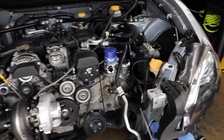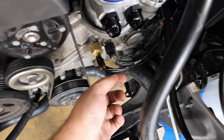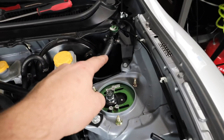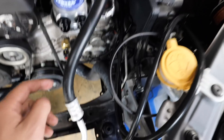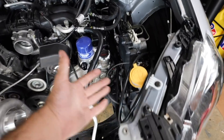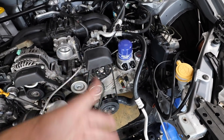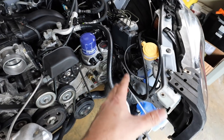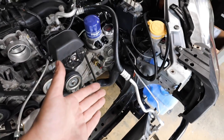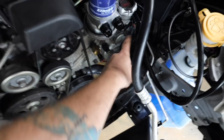We now have our oil pressure gauge wired in and set up. Here's our new AEM oil pressure sensor — the one we took out of the STI. The wiring goes up through a grommet into the backside of the dash, it's pretty accessible. I found a ground strap on the side of the frame rail and added a small ring connector to ground out the old sensor wire. That switch works on an open/closed basis: open means no oil pressure detected and the light comes on; closed means it sees pressure and the light stays off. So we closed the system so the car always thinks it has oil pressure. This only works with single wire configurations.